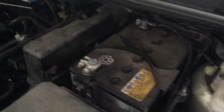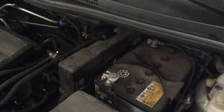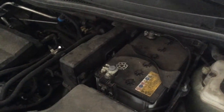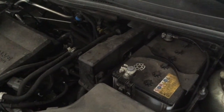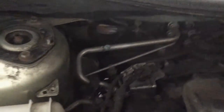So I've got the battery cover off, positive terminal at the front there, and I've got to look at how to route it. Now, in the videos online for a Mazda5, they routed along the brake lines, and I was going to do that. I'm going to try that, but as we get underneath, you'll see that there are some differences involved. So right now I'm going to look at routing it across along the top and back of the firewall, and then once I'm clear and over the exhaust, look at routing it down amongst the AC lines and down and along the side.